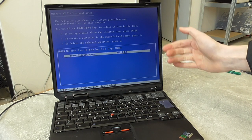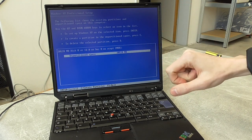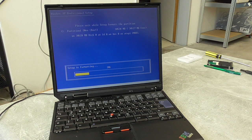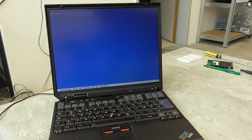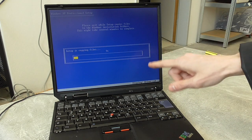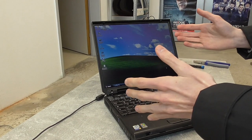I decided to include the install portion because it's interesting to see if the SSD is recognized. I was a little worried - it was stuck for a while and I thought it wasn't being recognized by XP. But it does recognize it - it acts as if it was an IDE drive through the adapter. Windows XP isn't used to such modern devices, so I was a bit silly to worry. Once it's copied it should go pretty fast since it's an SSD, maxing out the IDE bus.